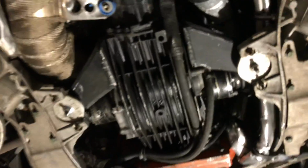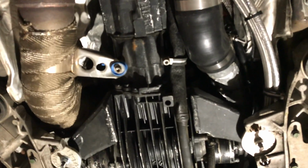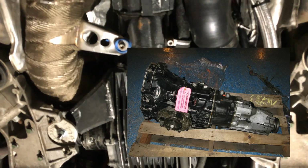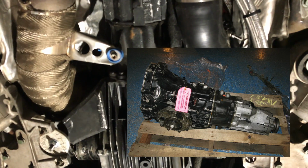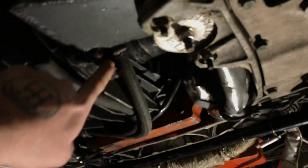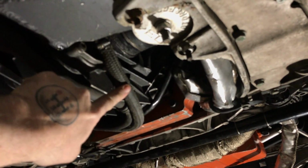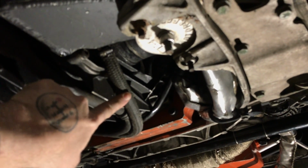The transmission is one that my friend Scott built for me. It's basically as rugged as you can make this thing without going to a straight cut dog box. It's a Euro TDI transmission, which means it has a very long 6th gear. It also has the front differential cooler pump, and this line goes out to the cooler that's built into the RS6 radiator for the auto transmission. We never got these cars with a manual here in the US.